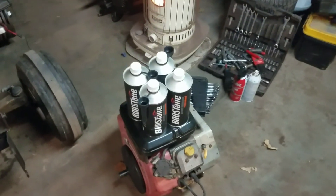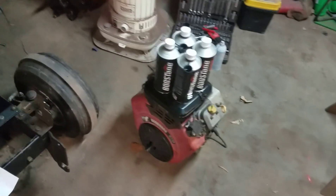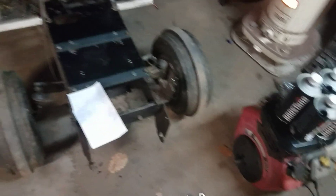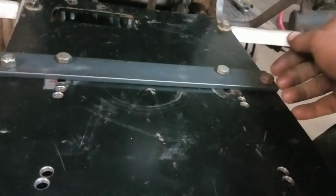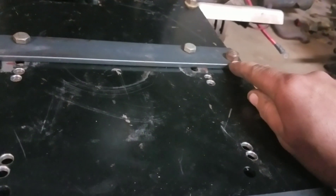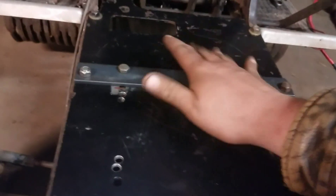I hope that helps. In other news, I got myself some octane booster so I can mix up some fuel to run my performance built engine. For those of you wondering about my performance built engine, I'll put a video in the description below so you can see what all I've done. Because this is going to be a hopped up engine, I added quarter inch flat stock to help reinforce this frame. Underneath here I added washers to grab the frame a little bit better, then tightened this down with some longer bolts to help reinforce that. I also added these bolts to help take any kind of wobble out of this frame.